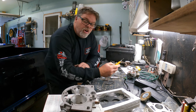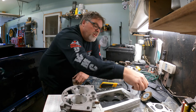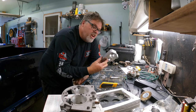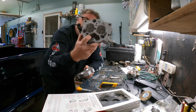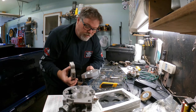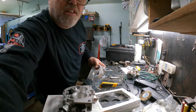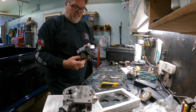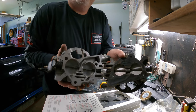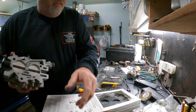Thanks to Steve at work, he had a throttle body repair kit, so we got that from him. We got an extra spacer thing here which I don't need because I got one here and it's already bored out to bore match the throttle body I got. Here's the differences between the bore sizes on these throttle bodies — quite a bit bigger.